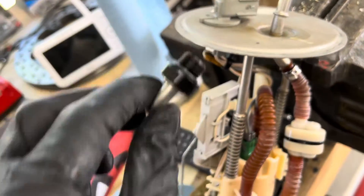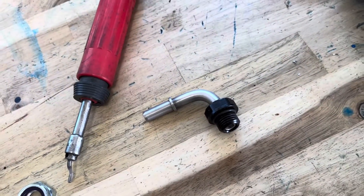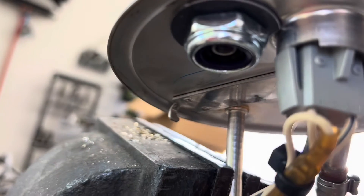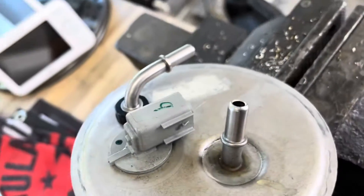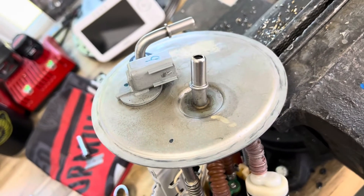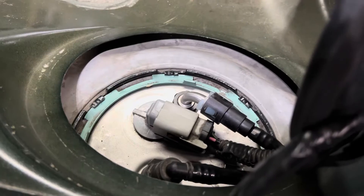Your nylon washer and nut will have a good surface to seal against. It's not really under pressure, but you still want it to seal well so you don't have fumes or fuel coming up on top. We're going to install that fitting — it's seven-eighths and three-quarter; the three-quarter wrench holds it and tightens enough so the nylon gets the first couple of threads. You'll feel it kind of bottom out. The cool thing about this fitting is it'll still swivel when tightened as much as possible, so you can throw it back in.